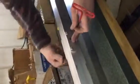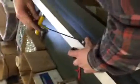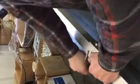Then first you start by putting the J handle in. I use a little Allen wrench to hold it in place to kind of feel around for that little paw. And you put the spring back in, put the shaft collar on there, push that tight against it, try to make that as flush as you can with this shaft collar, and then get it down to this flat spot that you'll see on the J handle, and then everything is in. You can make sure this other shaft collar is tight as well if you please. That one you use a 3/32 Allen wrench.